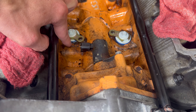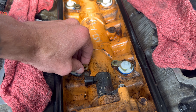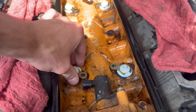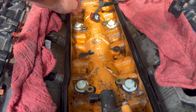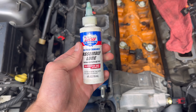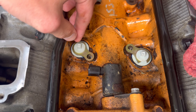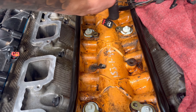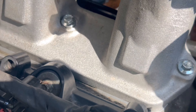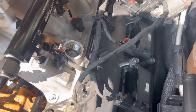I'm going to put some engine assembly lube on the o-ring of each plug so it doesn't rip or tear when I tap them in. The two back ones went in with almost no issues. I'm using a socket and tapping lightly with a hammer to get them seated enough to start the bolt, then the bolt will seal the rest of the way. The new bolts are in — honestly I'm a huge fan, they go on so much easier and look way better.